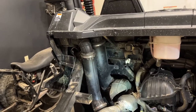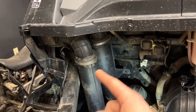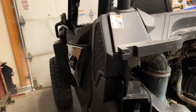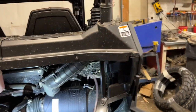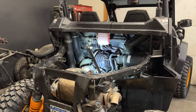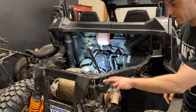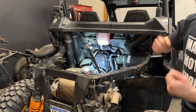The first thing I need to do is remove the inlet hoses and the exhaust hose — those two there and that one there for the CVT. Then I'll remove the grille right here, and then I'll need to remove the air intake hose and the air intake grille and the surface cover there. To make the job a little easier, I have removed the box. Simply take out the two bolts here on either side, then pull the pin and lift the box off.